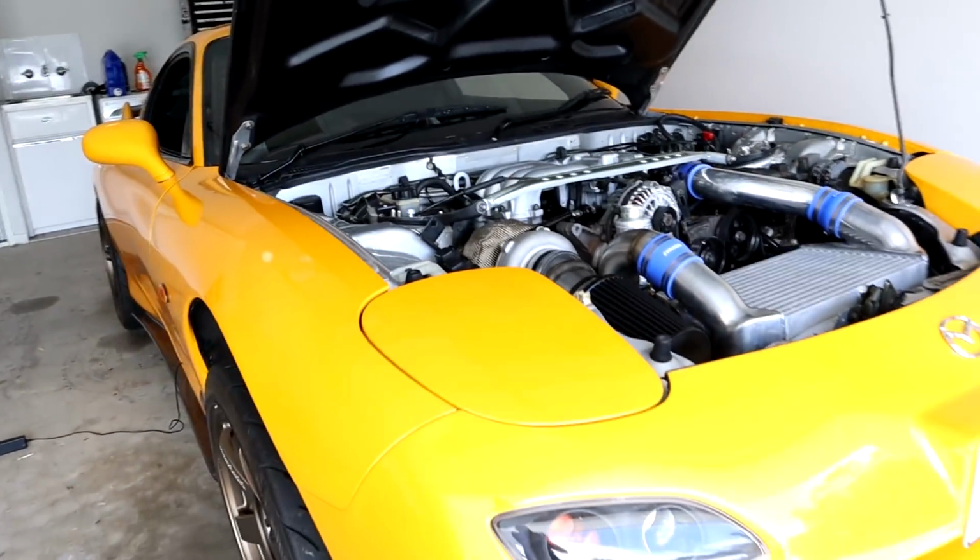It is just absolutely ridiculous. Everything about it blew my expectations out of the water. You guys can see from the dyno graph that the ATR45SS Hypergear that we have on the car is nowhere near its max. The turbo is just cruising at 14 PSI, and it is so incredibly linear. If we wanted to push this car with E85, we would see easily over 500 horsepower, which is just insane. I obviously don't want to do that, because that would make this car completely undrivable for me anyway. But yes, I'm very, very stoked at this entire setup.